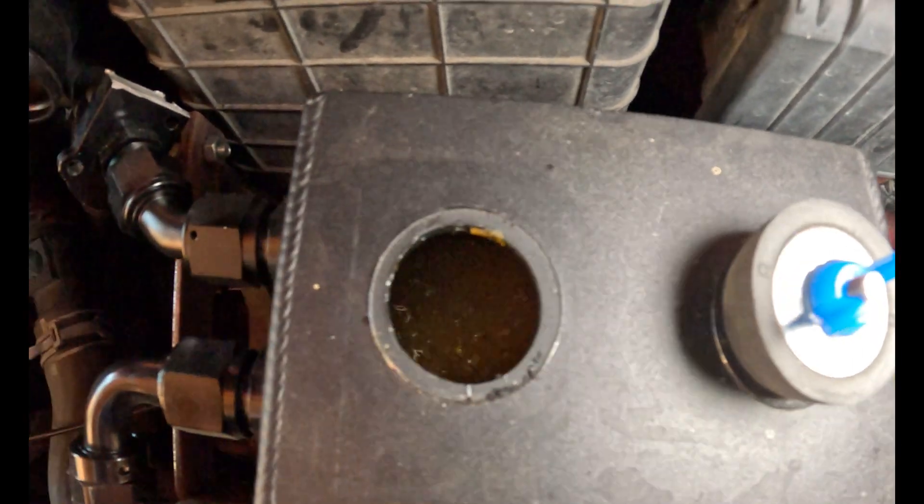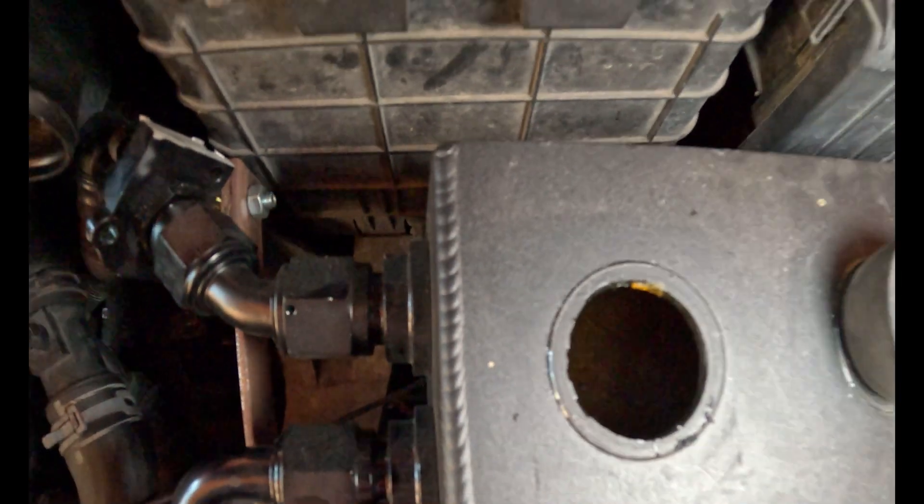The reason the can has plugs on top and not filters is because I ran filters at first and had a massive vacuum leak. With the PCV valve still hooked up and those filters on there, at idle it was idle-searching, idle-hunting — because the vent to atmosphere was actually creating a massive vacuum.